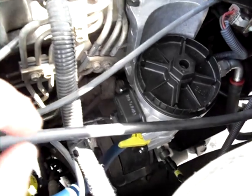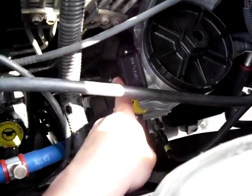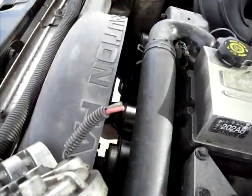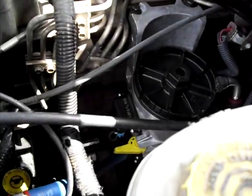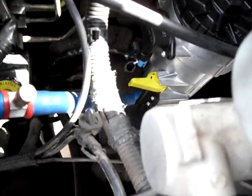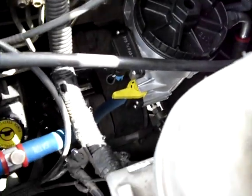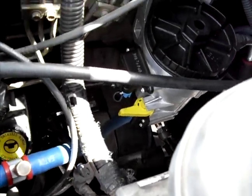One of the things I had to do for this conversion is get new wires and hookups for the fuel heater and the water and fuel sensor. I had to cut the wire here, cut the heater here, and get new wiring connectors from Cummins up north in OKC to do the conversion. Everything works, I'm pretty happy with it.